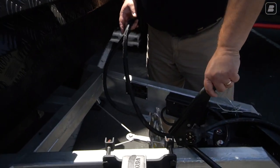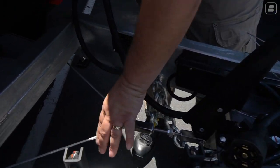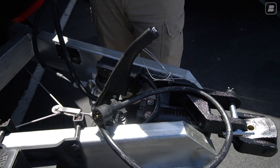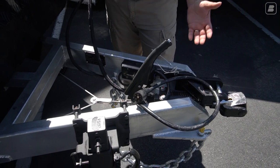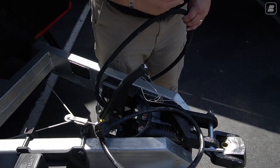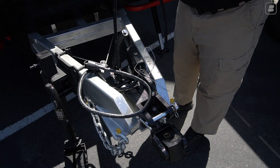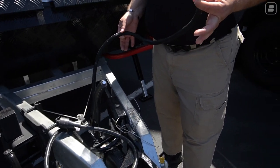On the tongue we have our mechanical handbrake with a cable adjustment. The handbrake is very handy when disconnecting from the unit — you should still use a wheel chock, but you can set the handbrake quickly. When connecting, releasing the handbrake lets the unit roll forward a little bit so you can give it a push with your knee to get everything hooked up.